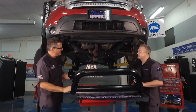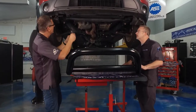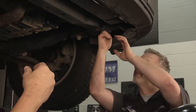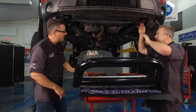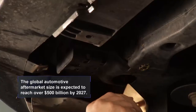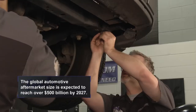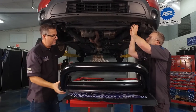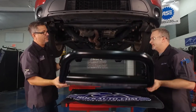Dave, Aries couldn't have made the installation any easier. You got this kit, I'll walk you right through it. Go ahead and take that first piece and put it in there. No welding, no drilling, no nothing — pretty nice. Second one you're going to take with the long side towards that to kind of hold it in place. Lock it in there — voila, just that easy. Simple — you got two places to bolt it now so we can go ahead and snake it up in there.